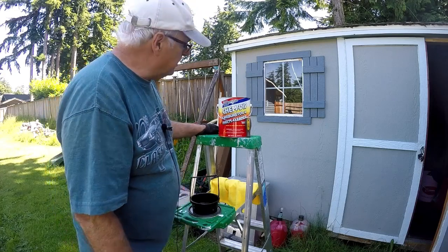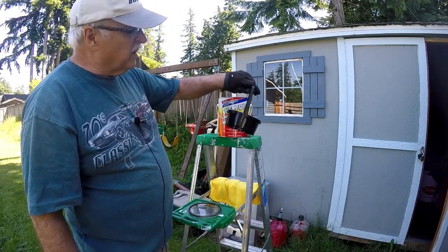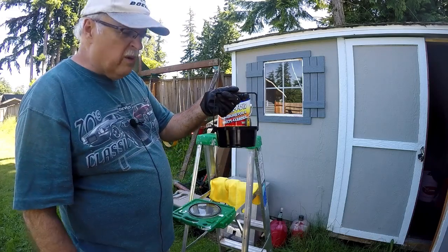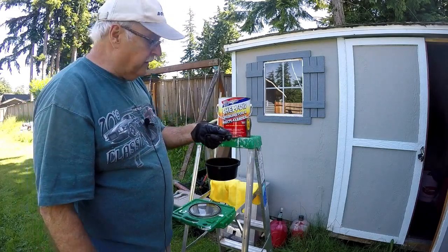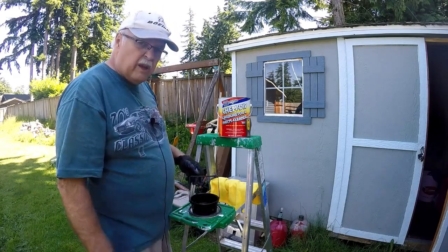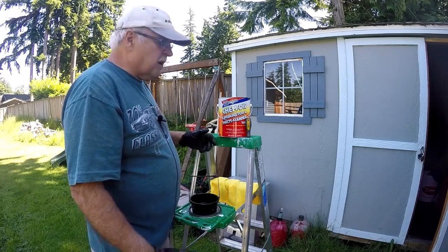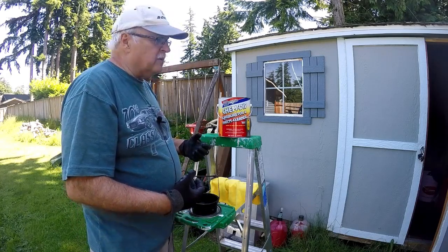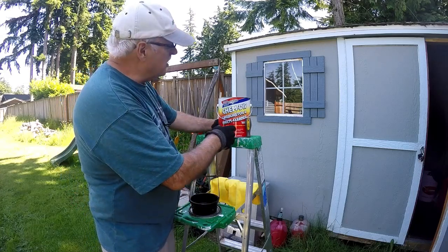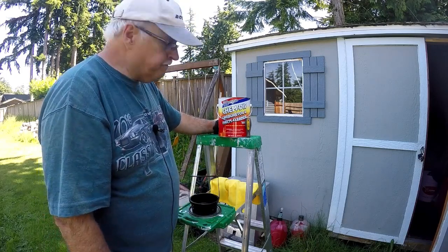It works really good. So here's a dip basket. You disassemble your carburetor and put the parts in here. I wouldn't put the float in there, it's plastic. But your jets and everything else you want to clean, get all the crud off. It also eats corrosion too, according to the directions on it. This is called Chem Dip by Berryman.